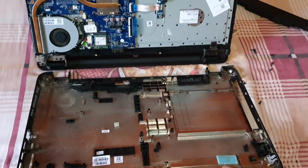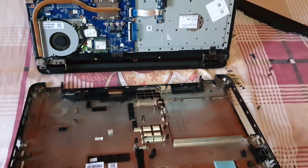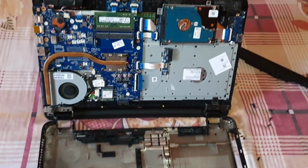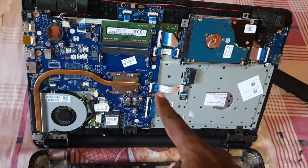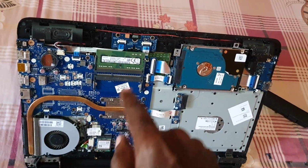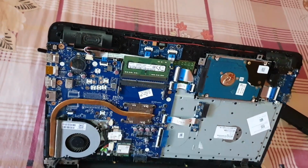Also, when you're separating, make sure not to yank everything off. In some devices, they do add a speaker on the back cover, so if you yank this to separate, it can damage something. Everything is connected by ribbon cables. Ribbon cables can be removed, with each component being removed, including touchpads. There's the speaker over there.